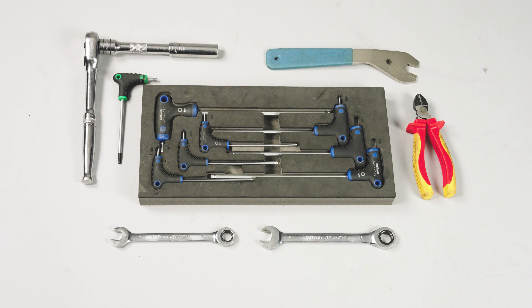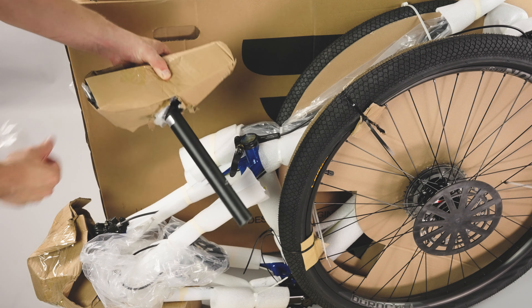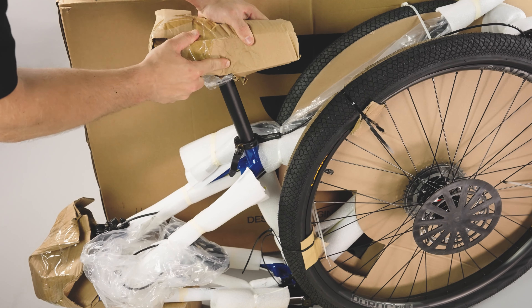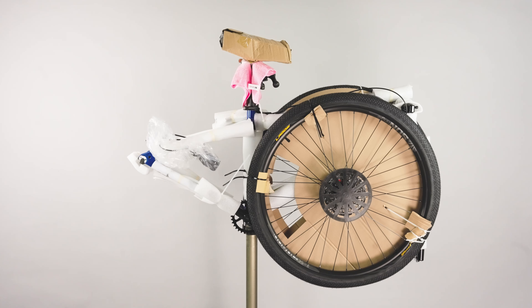For the assembly of the bike we recommend the use of mechanic grade tools. Other loose parts will include a pre-fitted seat and post combo which will be stored in between the rear triangle of the bike. Remove the seat and post and install it into the seat tube of the bike. Tighten the seat clamp but leave sufficient post out for use in a bike stand. We always recommend using a bike stand where available.